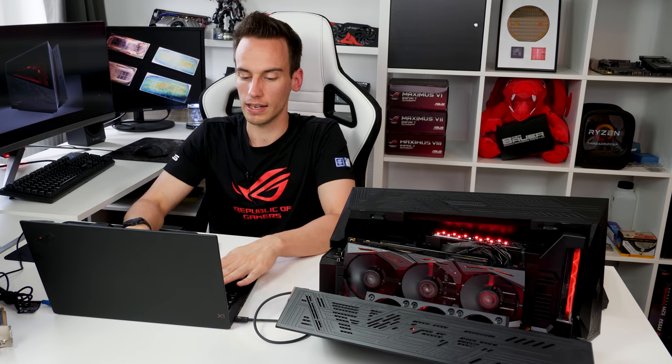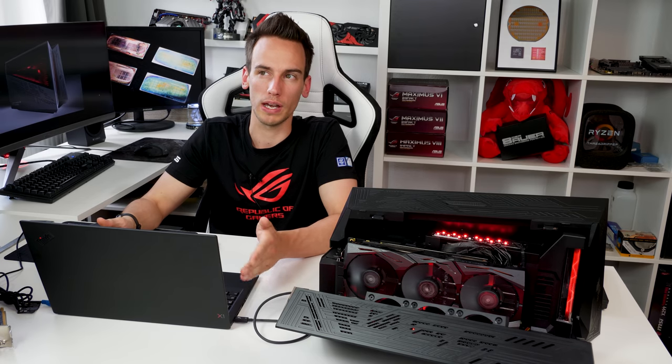So it really didn't make sense to keep a laptop with a dedicated NVIDIA GPU that's also fairly slow. I thought I could just get the X1 Carbon, which still has the internal Intel CPU and Intel iGPU — an HD 620 — which is fine for working but not suitable for gaming. The CPU in the X1 Carbon is an i7 8550U, which looks like Coffee Lake but is actually based on Kaby Lake, very similar to an i7 7700K except with lower power consumption and lower clocks. It's 4 cores, 8 threads with the same cache — quite efficient and strong for a laptop of this size.